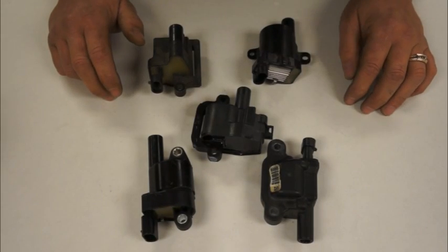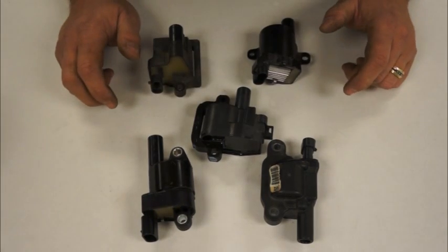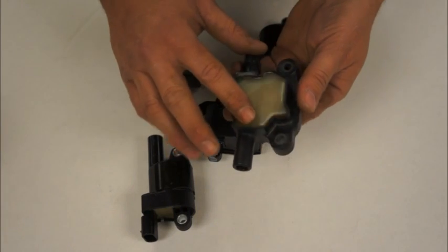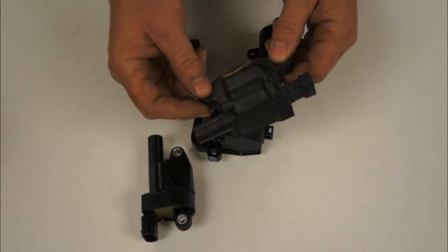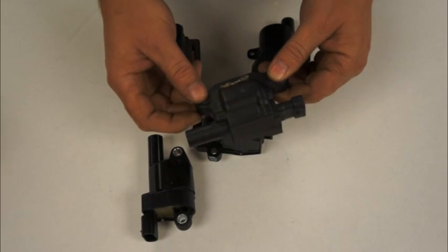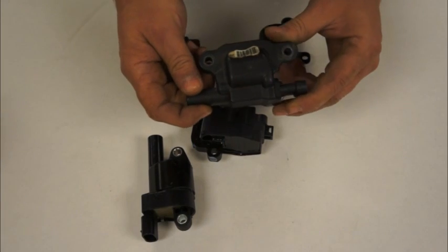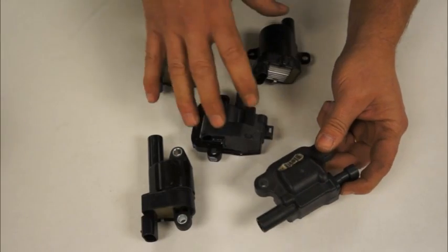I want to give you a brief description of each coil. These are the typical five coil packs that you will find on an LS engine. This first one is flat on the back, has a long gated connector, and is a solid base piece. These coils you will typically find on LS2s, LS3s, and sometimes an LS7. You're going to need to know what kind of coil you have so we can program the computer correctly, because each coil has a different dwell base.